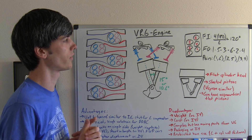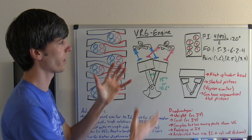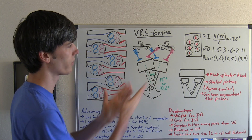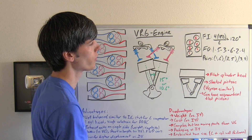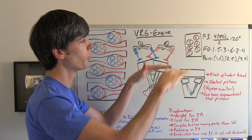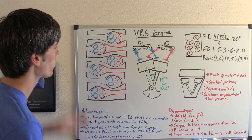If you've watched my video on inline six-cylinder engines, you'll notice that that is the exact same firing order — because this is basically an inline six-cylinder with a little bit of a V put into it. Cylinders 1 and 6, cylinders 2 and 5, and cylinders 3 and 4 move up and down together in pairs, just like they do in an inline six-cylinder engine.